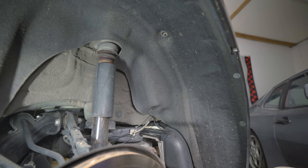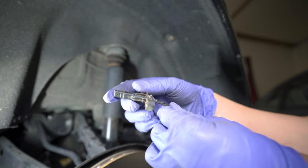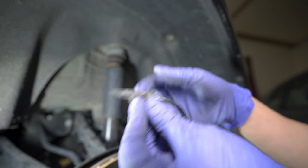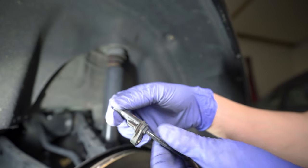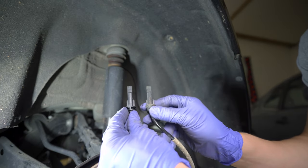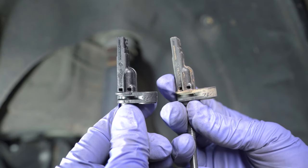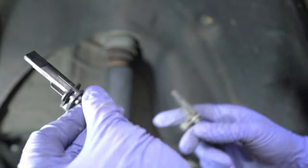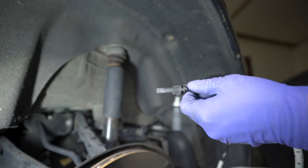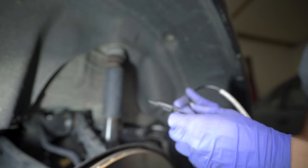A hundred years of dust just came out of there. There is the original wheel speed sensor out of the car, and it doesn't look damaged at all, so I'm hoping that just swapping it will be the fix. Here's a quick comparison — I've got the new one on the left and the old one on the right. The only difference is the new one doesn't have the BMW branding on it, just the manufacturer logo. I'm going to put it in the same way I took the old one out and make sure I reroute the cable so nothing gets pinched while driving.